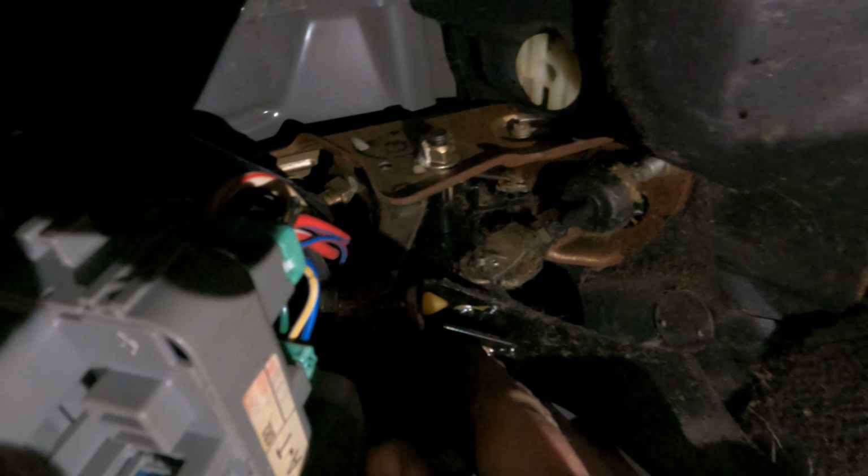But while I'm down here, I want to show you guys something. I don't know if you can see this white piece? That's on the clutch pedal. Well, the brake pedal also has one of those. Okay, so it's right, this is very awkward, right where my fingertip is. Mine actually broke and the brake lights are staying on. So, I can't find it now. Oh, there it is. I put a nut and a bolt in there, and it presses the button. Before I give you guys that little tip, I guess it's a pretty common thing with these.